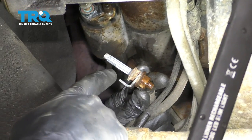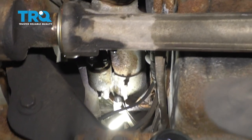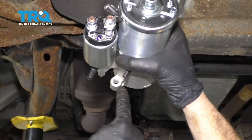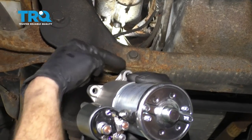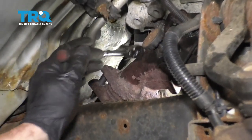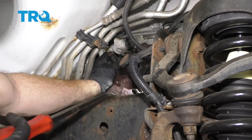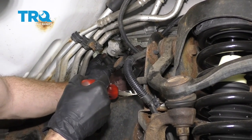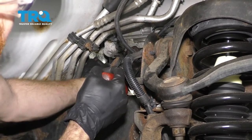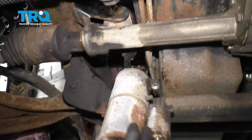For us, it took out the whole bolt, so we're gonna separate this so it'll be apart. Now that we have that lower bolt out, we're gonna continue on by removing the other two mounting bolts. If you were to look at the new starter, you can see where the bolt is that we had removed. The other two are gonna be located up above the solenoid and then up a little higher — they're very hard to see. To get to the upper bolt, it's much easier if you just come in through the top here with a pivoting quarter-inch ratchet and a 13-millimeter socket. I'll put it right on the bolt and then use a nice pry bar to hold pressure on it while I remove the bolt. All the bolts are out — let's go ahead and grab that starter.